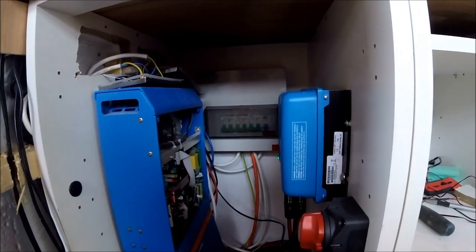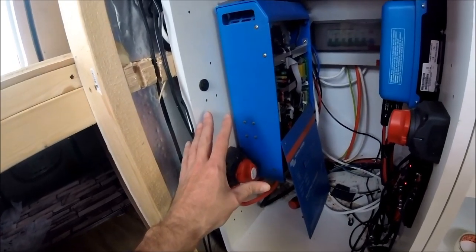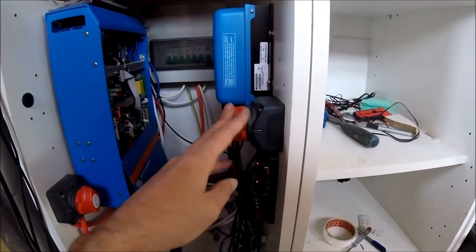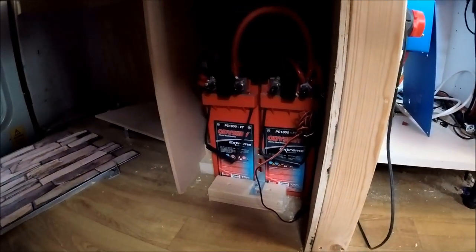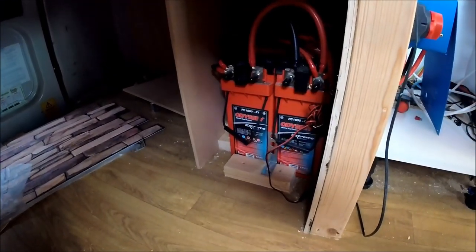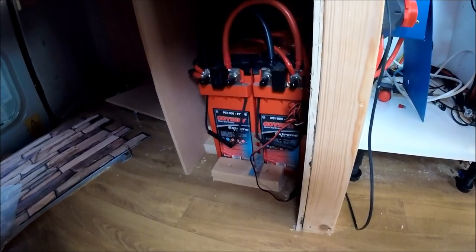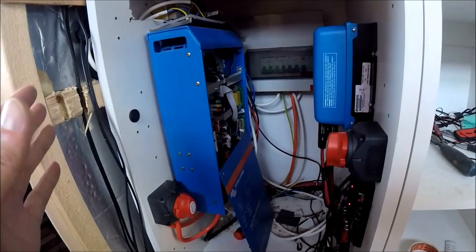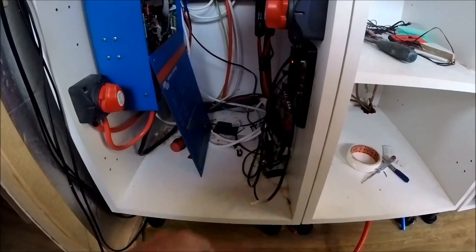There's a hookup point mounted on the side of the bus. In the electricity cupboard I've also got a few safety cutoff switches — one for the inverter so you can turn the main charge going to the inverter from the battery bank on and off, and one for the 12-volt system so you can turn the entire 12-volt system on and off with one master switch. All the electrics are fed by two Odyssey 214-amp power batteries, giving over 400 amp hours combined. Those are marine-grade dual-purpose AGM batteries that can be discharged to 80% over 400 times without damage.